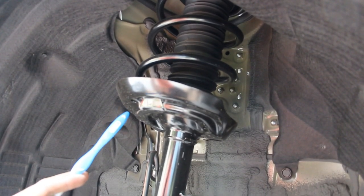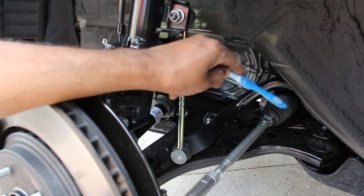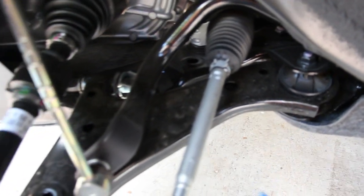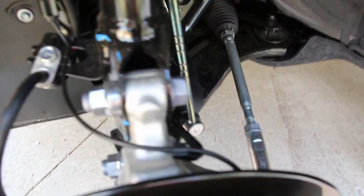Taking a look at the Highlander's front suspension, things are fairly simple here with the McPherson strut design. That bolts up to this aluminum front knuckle here. You've also got your sway bar linkage over here that goes to the sway bar and then over to the steering rack, as well as the inner and outer tie rod. This suspension design is pretty much as simple as it gets — you have a stamped steel lower control arm here. Replacing this control arm is pretty straightforward with just two bolts that are easy to access and your other frame bolt. Down on this side of the control arm you have a bolted-on ball joint with a castle nut, which means you don't need a press to change out your ball joint. With aluminum knuckles you've also got a bolted-on bearing — just four bolts and you can easily change that out without a press. The McPherson strut design isn't going to be the best off-road but it's a good compromise when it comes time to repair, because things are going to be pretty simple to work on and cheap to replace.